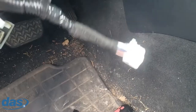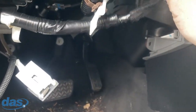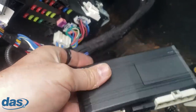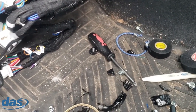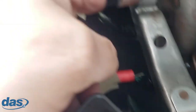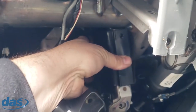Okay, I got everything electrical taped and put some Tesa tape on the outside to clean that harness up — it looks pretty nice, much more like stock. I'm going to leave it unplugged since we'll be plugging the T-harness for the Directed unit in there. I was able to fashion a little bracket out of an old dash kit I had lying around. Up towards the top of the brake mount I was able to put a threaded insert in, which will give me a nice solid spot to mount the brain.